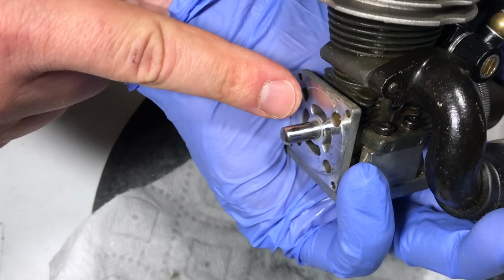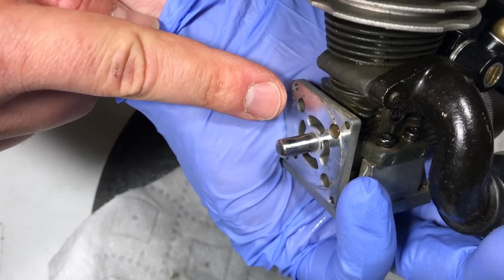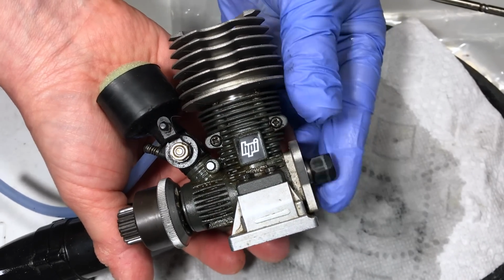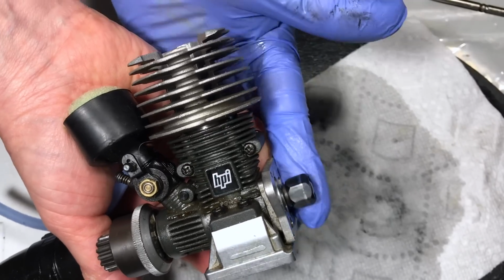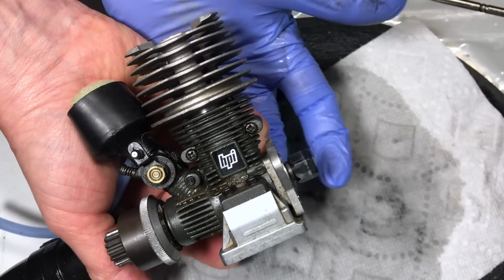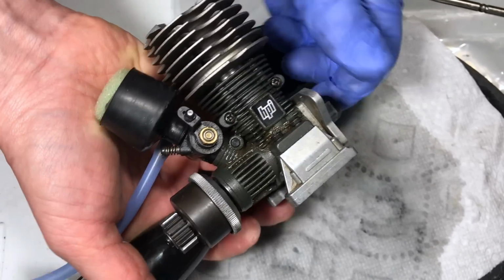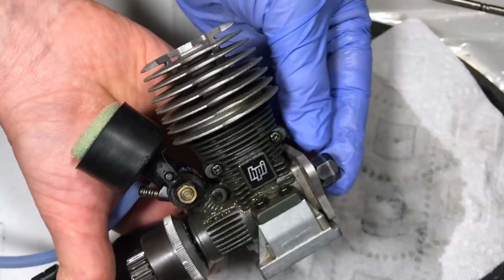I don't want to take off too much material because then the roller bearings in the one-way bearing will not catch at all. Let's see, hopefully it still catches. Okay, yeah. I'm spinning it with one finger in this direction, and it does not spin the other way. You guys can see that? Yeah. So far, so good. Oh, so much compression. I can't really spin this over.